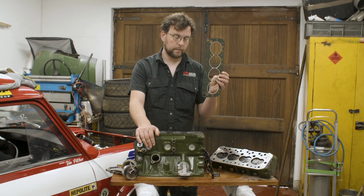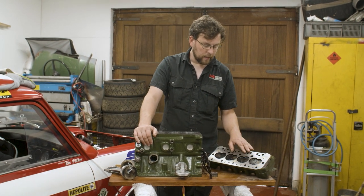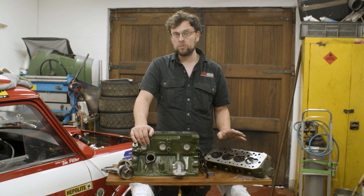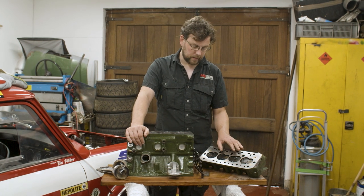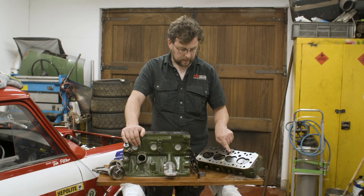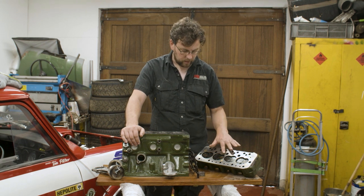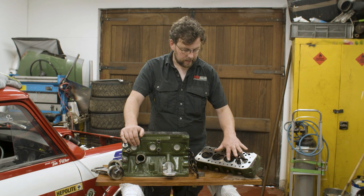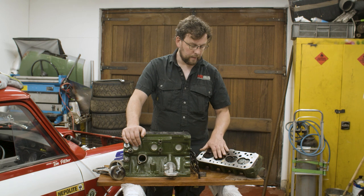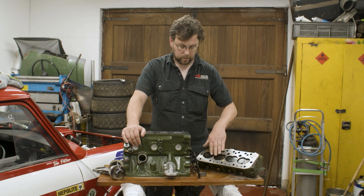That certainly didn't help our campaign at all, but it certainly wasn't the cause of the problem. The cause was the pistons hitting the firing rings in the gasket. The cylinder head, when we skimmed it — amazingly it has done less than 15 hours of racing since it was last skimmed — we still saw a shadow in this area, indicating distortion in the cylinder head. We took 0.1 or 0.2 of a millimeter off, and it's clean as a whistle now with a really good surface finish.